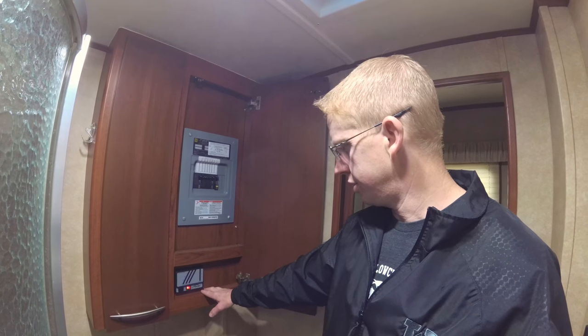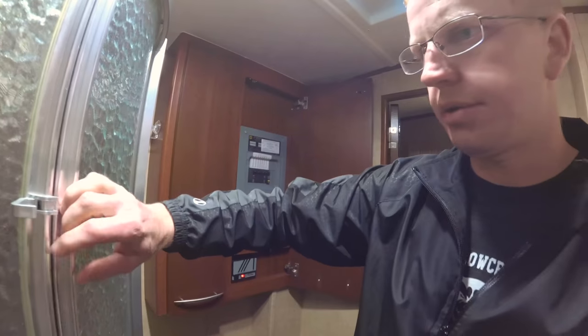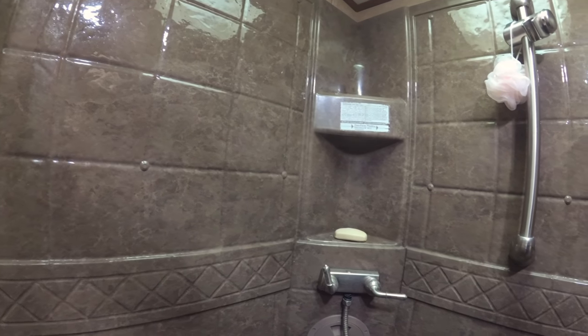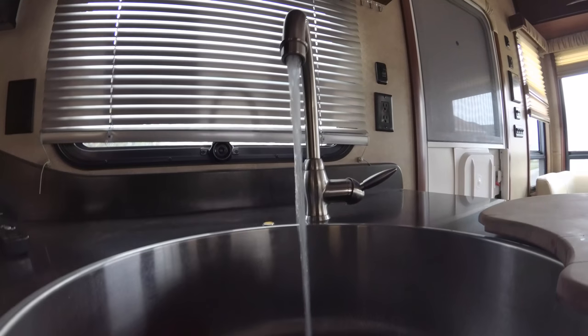Turn on the pump, flushing out all the lines. Not really going to worry about the toilet too much because bleaching that line won't hurt too much — just want to make sure it works. Into the shower now, and this will just be the cold water lines because we turned off the hot water lines. You just want to run enough through to make sure you don't smell the bleach anymore. I can still smell bleach, so I'll let that run while it runs the bleach out. While that's doing that, I can also get the sink going. I can still smell the bleach, so I'll let that just keep running through the sink as well.